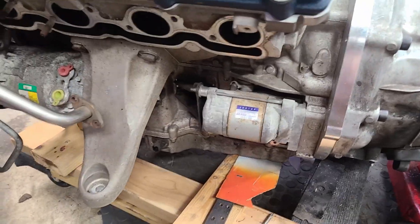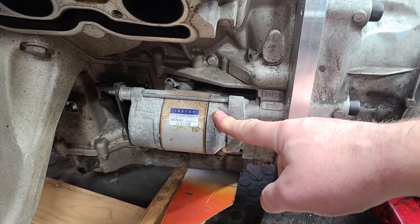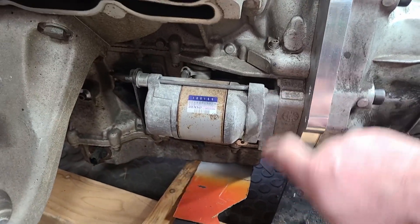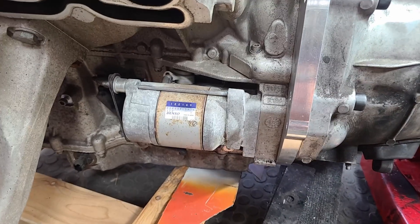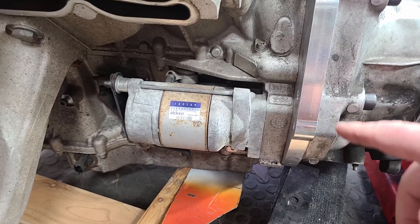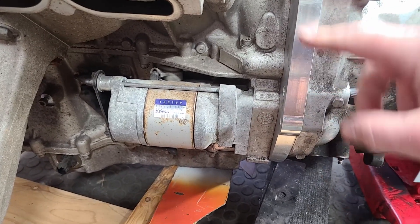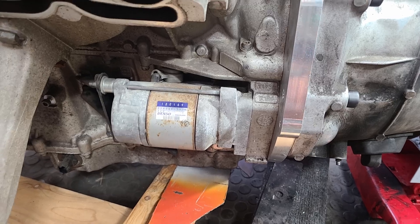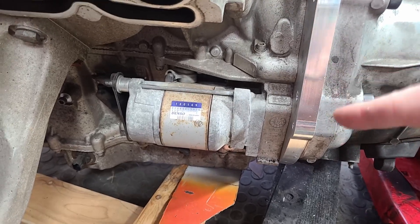Hey, it's future Jeff here. If your engine didn't come with a starter, definitely get a starter before you try to install this kit, because the three bolts for the starter all go in from the flywheel plate side or the adapter plate side. So in order to change the starter, you will have to take the transmission off, which is actually pretty similar to how the stock setup works. Do yourself a favor — get a good starter before you put all this stuff into the car, because that will make a huge difference.